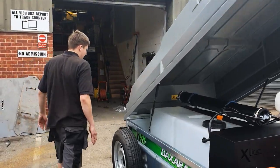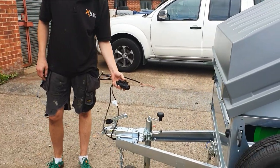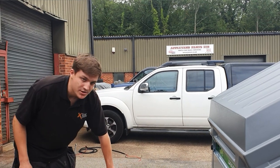If you come round to the front you can see we've got the split relay going onto the socket of the actual trailer itself, so whichever vehicle they're using they can just hook straight in and as they drive around it will keep that fully charged.